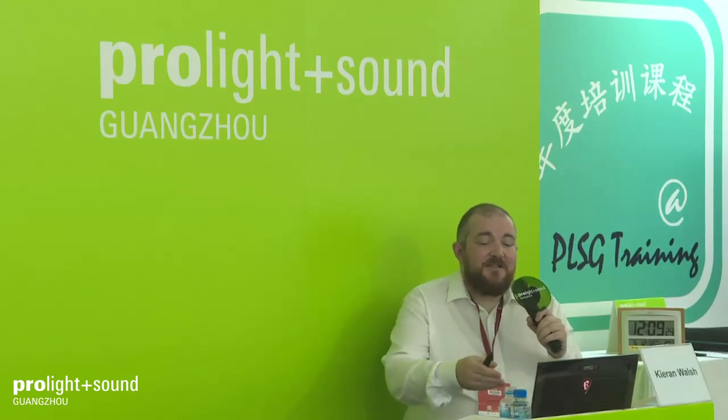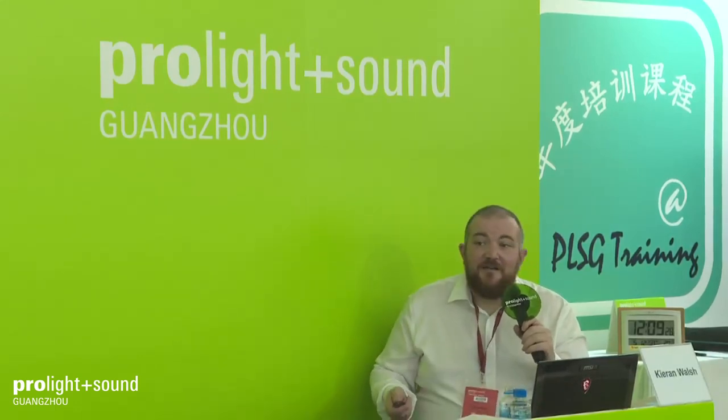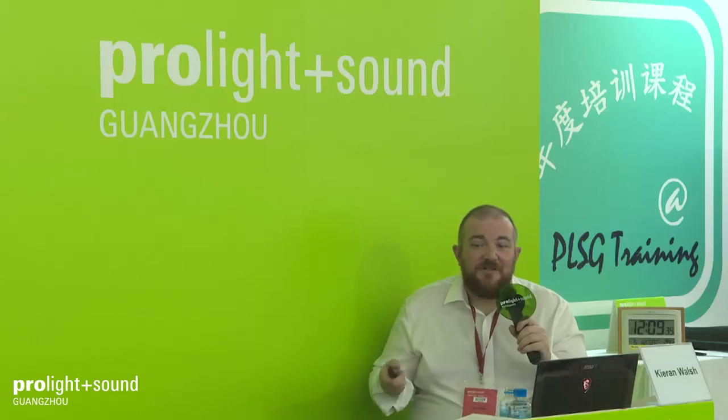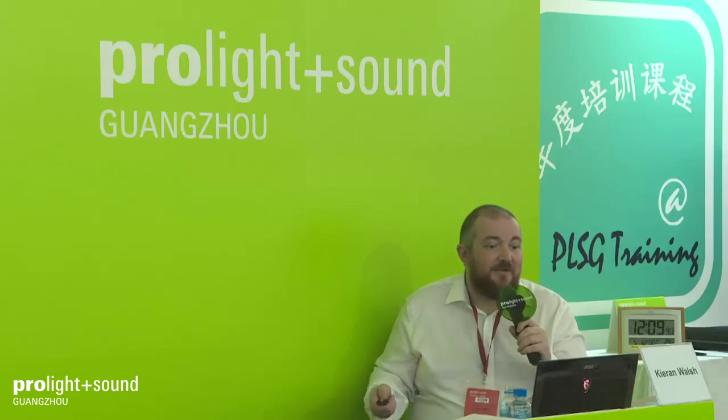You would apply a different set of criteria using access control lists, like shown here, and you would generate your own criteria based upon MAC address, maybe based on username, based on a bunch of secret functions, so that you can be in control of the bandwidth used in your network based upon your criteria.